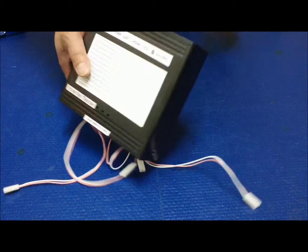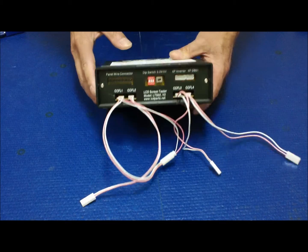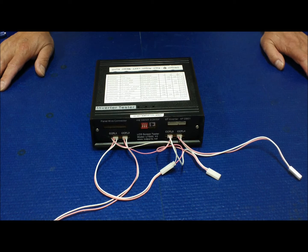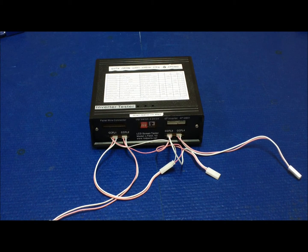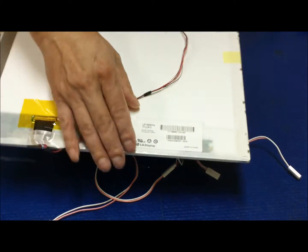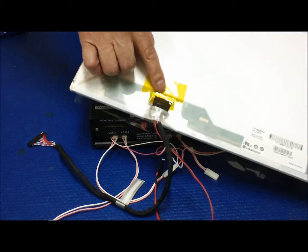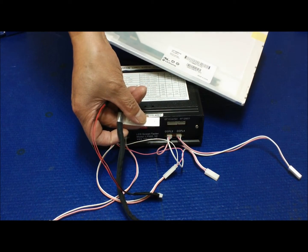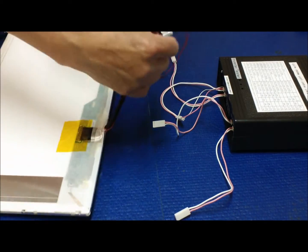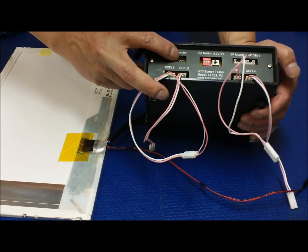It's quite simple. First disconnect the cable, then disconnect the DC power. Set all jumpers to off. If you have the screen part number you can go to our site's cross-reference table to look up the wire harness, but for 1366 by 768 screens it's usually the iPEX-20455-040 wire harness. The screen I have here is a 15.6-inch made by LG Philips: LP156WH4. Connect one end of the iPEX-20455-040 wire harness here.